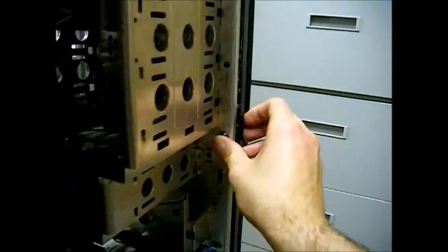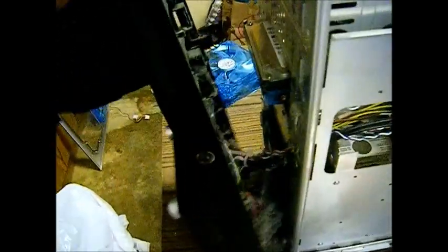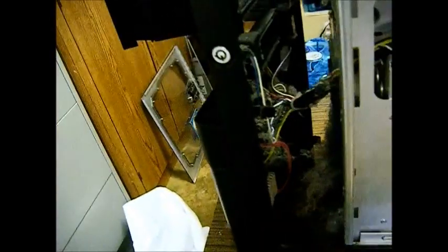You just kind of push and push out. That's already half of them off. Now go to the other side and do the same thing — there's a clip up here. For stuff like that you might want to just get your screwdriver and push it in. You're going to need both hands for that obviously, but same concept. You do not want those wires to rip — with all your power buttons, USBs, and everything in the front. But there you go, that's how you get it off. See what I mean — there's so much nasty dust in there. You want to clean all of that.